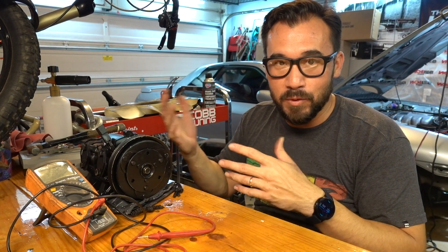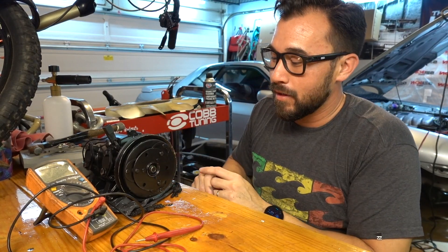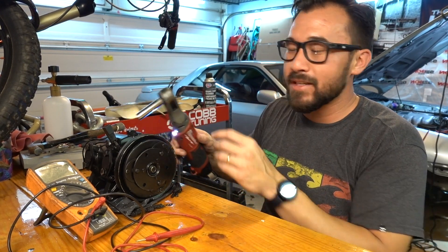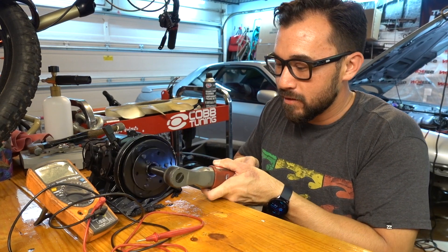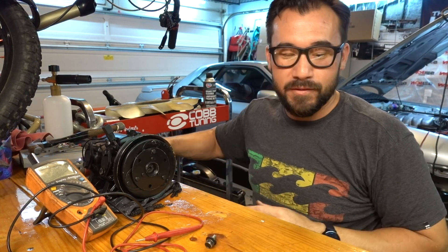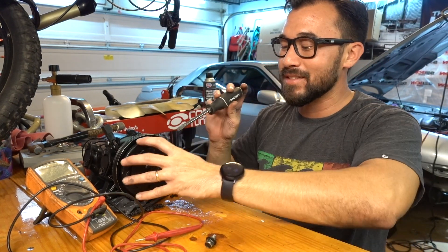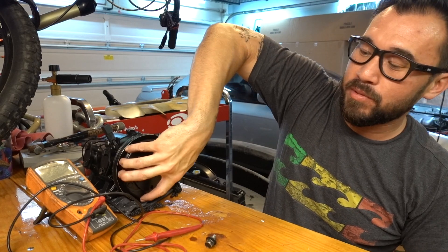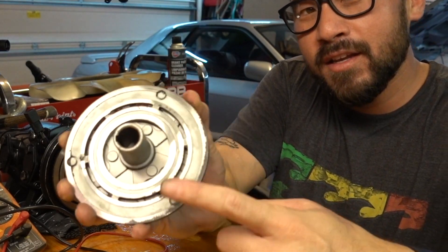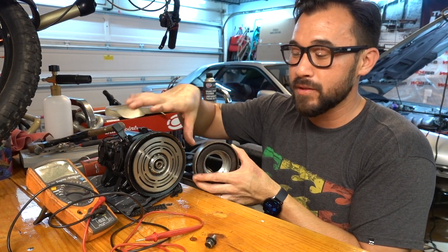Then you're going to have to deal with refrigerant, and that's more money. So if you're doing this on the car, you want to take it apart and replace just the coil. It's got a bolt right in the middle. Sometimes you need a tool to hold the pulley and prevent it from spinning, but if you've got tools that are fast enough you can get the bolt out without it spinning. Take the bolt right out. Now the cover or the plate you can just pry off. Sometimes there's a little washer down in here you're going to need to reuse. The coil lives behind this pulley, so the pulley has to come off.